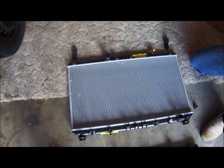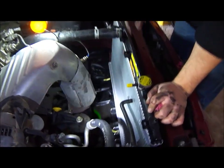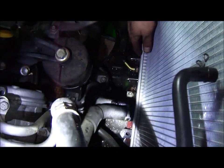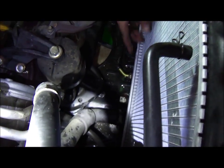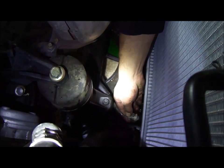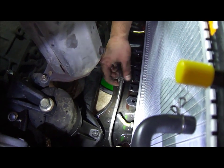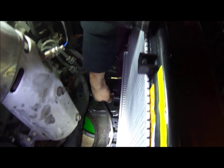The brackets will go in place once we put the radiator in. I'm going to put it in there, attach the bottom hose, and put it in place. The radiator is back in place — those rubber mounts on the bottom slip into the appropriate holes in the metal frame, just like that. I already attached the bottom radiator hose and the sensor is already in there, so go ahead and attach the electrical connector. We'll worry about the rest of the connectors when we're putting the fan housings in.